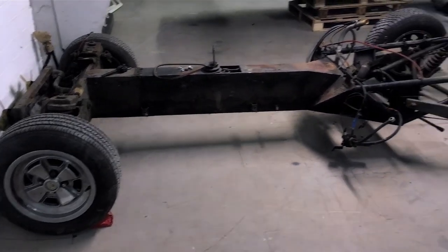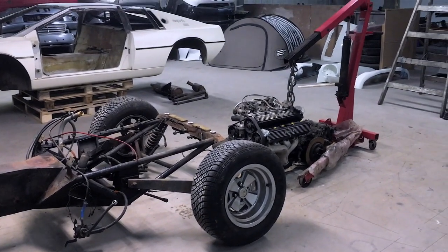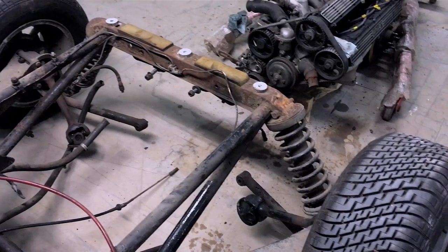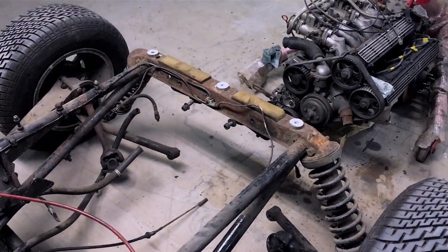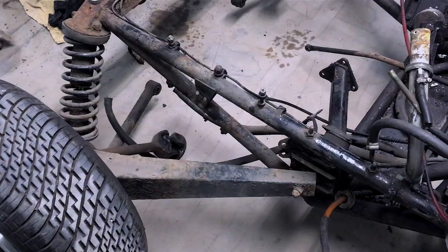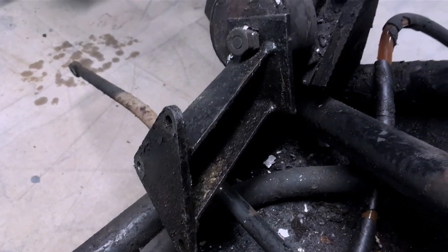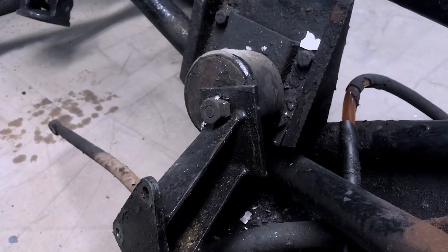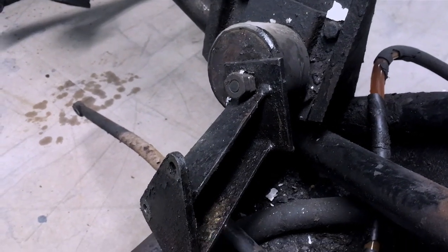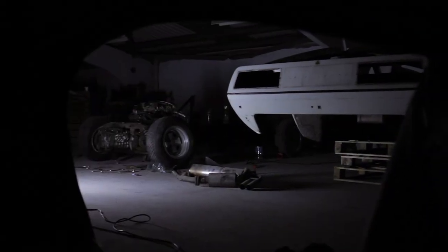Here's our little rolling chassis. It is not going to take much to get this thing bare at this point. That upper cross member at the very back of the car is the worst off of all, but I think it's perfectly saveable. Here's that engine mount — it's since swung down, it's not right at all. There are modifications that can be done to these mounts and we will look into those.